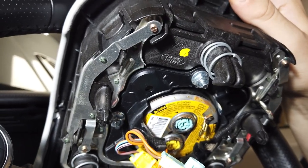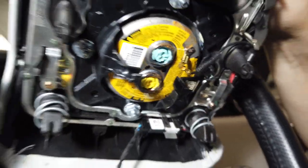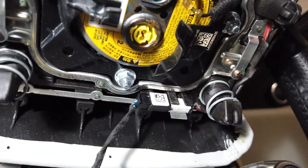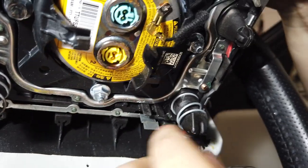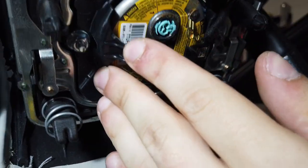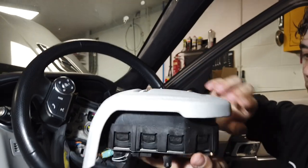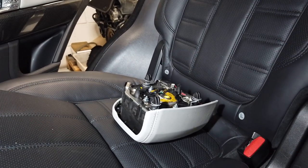Pull that — you've got yellow and blue plugs and yellow and blue bits on the airbag, so you can't get that wrong. Unhook those wires — that just unhooked out of that little hook there. There's a second connector at the bottom held in by a little metal clip — push that little metal clip, push that back, and that releases the connector. Then just give it a good pull apart. That's the airbag — put it gently on the back seat because that is an explosive device.